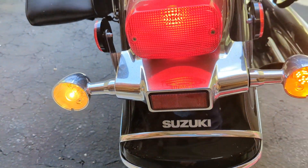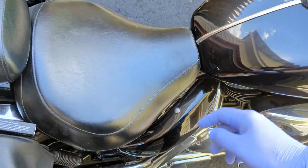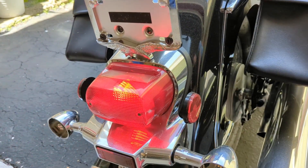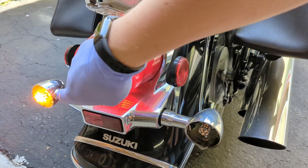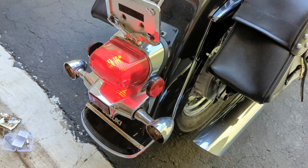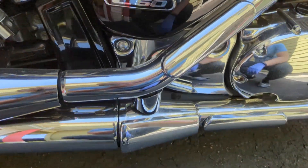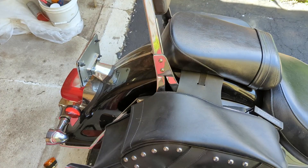Hopefully they don't burn out on me. One other thing: you're going to get hyper flashing when you do normal turn signal operations, as you can see here. That's because the LED draws much less power. What you need to do is either install a load resistor. What I prefer is, once you swap out everything to LEDs in terms of turn signals, you would want to install an LED relay, which is a small little electronic device. I will have a second video on how to do that, so make sure you check that out.